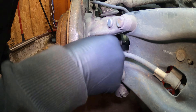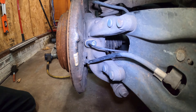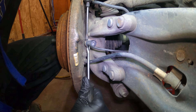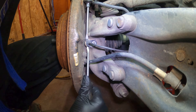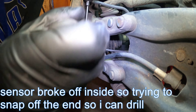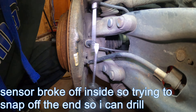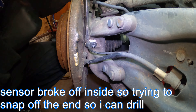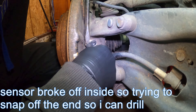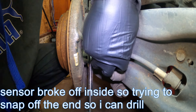Got the Honda — it's got a right rear wheel sensor malfunction. Looked at the scan data. Got the ABS light on and all those fun lights on the dash. I took it for a drive and this wheel was responding sometimes and sometimes it wasn't. The speed on this wheel was off and on, and when looking at the freeze frame data, she was doing 36 miles an hour on all three tires and this one was at almost 60, so something's going on here.